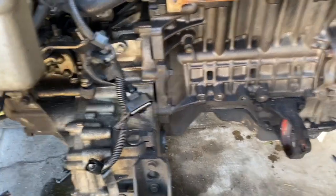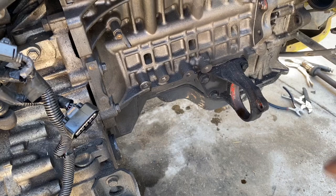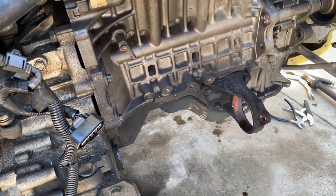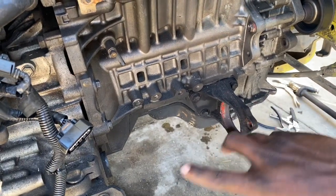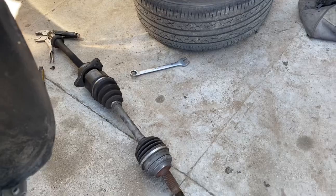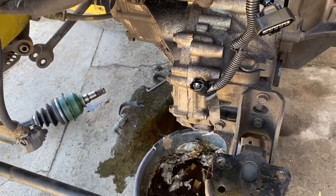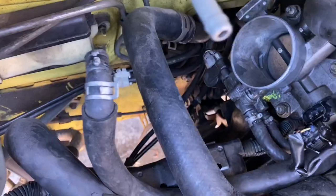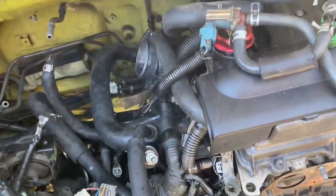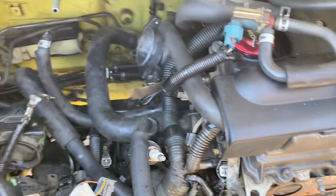I went ahead and disconnected the half shafts and axles already too. Starting to get a little tired — this thing is a little harder to work on than other cars just because it's mid-engine and doesn't have much room. But it's just two 14 millimeter bolts and then it slides out with the shaft. The other side you just pry out — you have to pry it hard enough to reach that pin and it pops out. I also did the fuel line already — it's just a little clamp at the bottom, a gas line I'll show you later once we drop the engine.